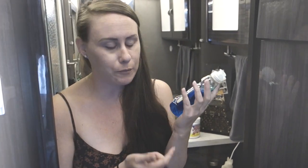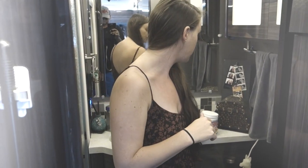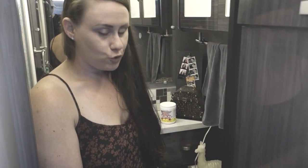You want to get a couple gallons of water in there — that just helps break up all the stuff in the tank. If you don't use that, you might also want to use Dawn dish soap. I use Dawn because you can use it on animals — obviously there's a duck on the label — so if you can use Dawn on animals, it's probably safe for the environment. The Happy Campers is also organic, so I try to use things that won't hurt the environment because what comes onto the RV has to go off the RV. Everything that goes out of the toilet goes into the black tank, and all that stuff — toilet paper, number one, number two — needs to break up so it doesn't get stuck. There are sensors and things like that.